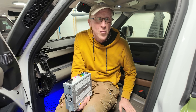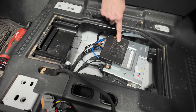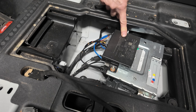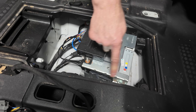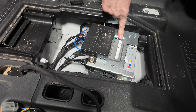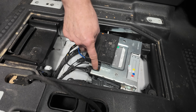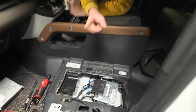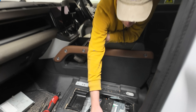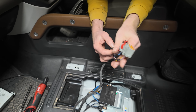Let's get this seat out and have a look what we're doing. So to get here, I've disconnected the battery for unplugging and plugging things - always a good idea to disconnect the battery under this seat. I've had to remove the seat so we can all see what's happening. You could probably do this without removing the seat, but it's easier. There are airbags in the seat, so obviously if I had the battery connected it would get upset because the airbags are disconnected.